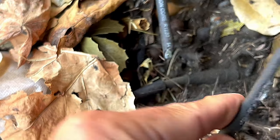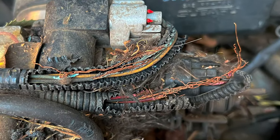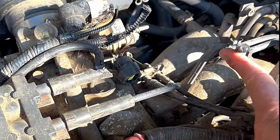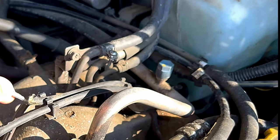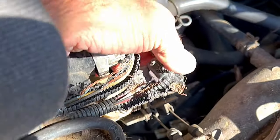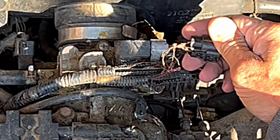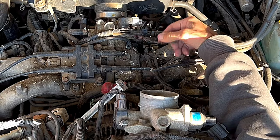That's just a spark plug wire — no big deal. There's another one right there. And that's a whole fucking wiring harness. Fuck my life. Got that whole mess cleaned up. It looks mostly like it's just this: there's two spark plug cables that used to connect here that are totally gone. And then we have this harness here that's shredded, and then this one that goes back here that is totally shredded. This is a problem.